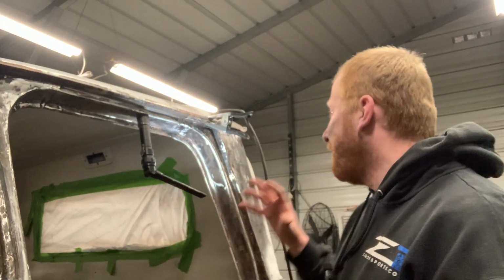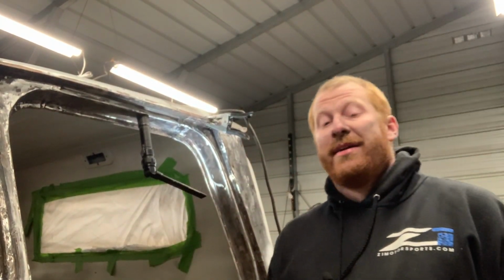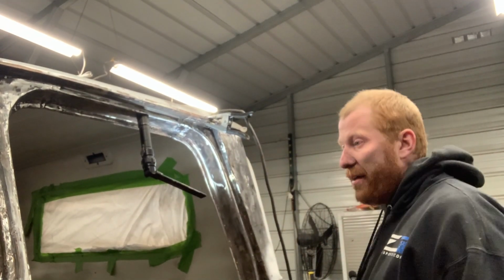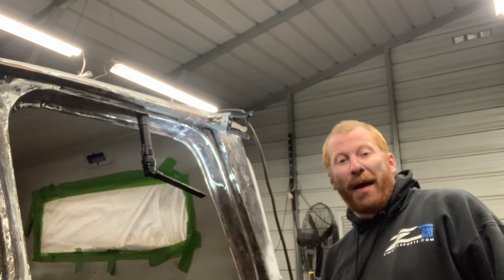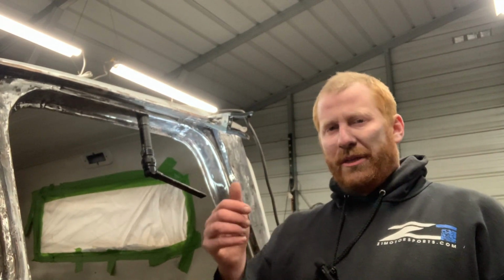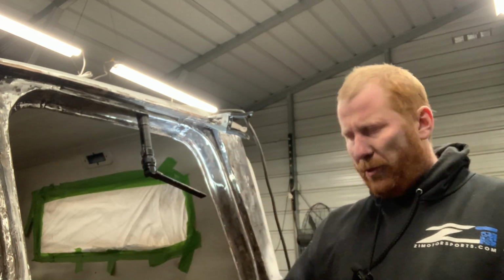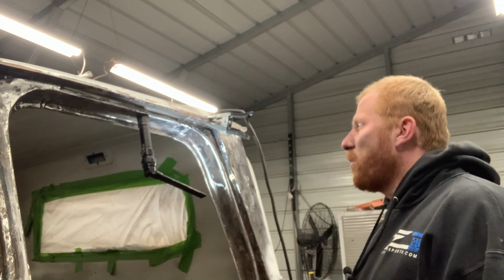So we have this ground down, as well as the very bottom and the whole sail panel done. We also got this cab corner on the outside, on the body side, the door side complete. We still have the back here to do, but again, I'm going to need to get a dent puller, a slide hammer. So there's the stud gun where you just zap it, puts the stud in, and then you pull it out.